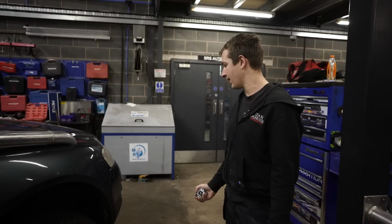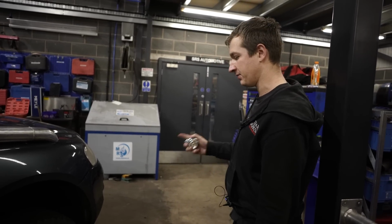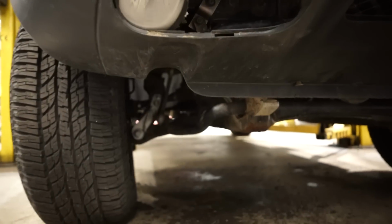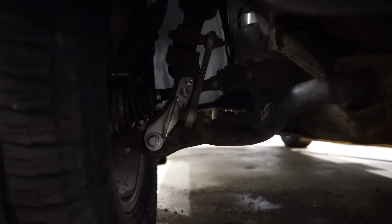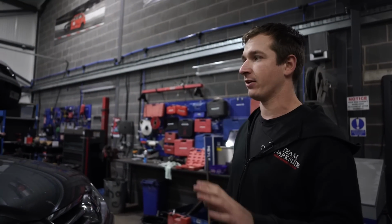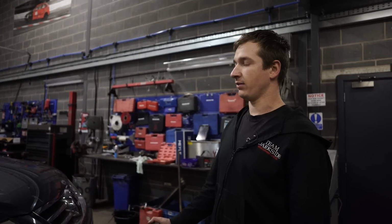I don't think it's gonna have any adverse effects, so we'll try it. The CVs don't look at too bad of an angle as they are now, ignore all the brake fluid he kicked a tub over. You see dry shafts there. And when it's jacked all the way up, we've just checked them and they still do turn, there's no funny noises, but the true test will be getting it on some trails, and when you pop the front over, that's usually when I had problems with the V10.